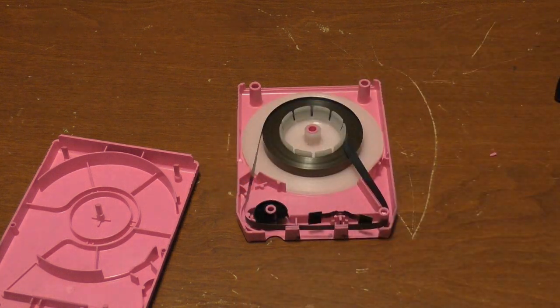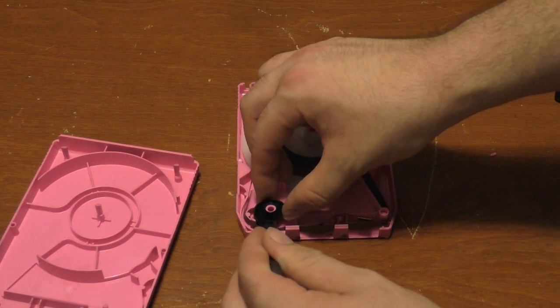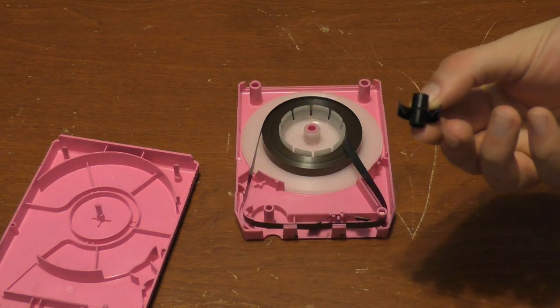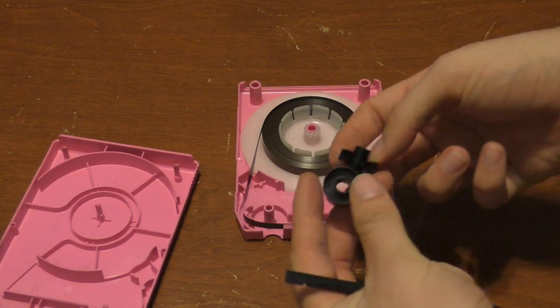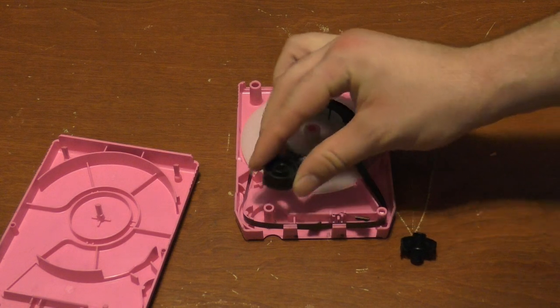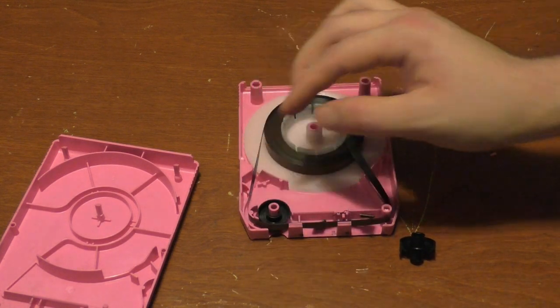It worked well. This brings us to our other problem, though. The plastic pinch roller right here. Now, the pinch roller exists to help the tape pull along, and this one snapped while I was playing it at one point. So I'd like to get another one of those in place. Now, I'm fortunate in that these things are usually pretty universal, so I'm hoping I'm going to have good luck with this other one that I just happen to have lying around from another broken tape. Guess how I figured out about the whole unspooling problem. So, let's see if this will fit in here. I really hope it does, and...